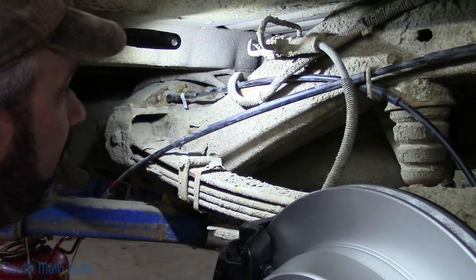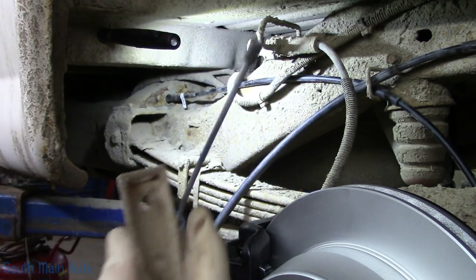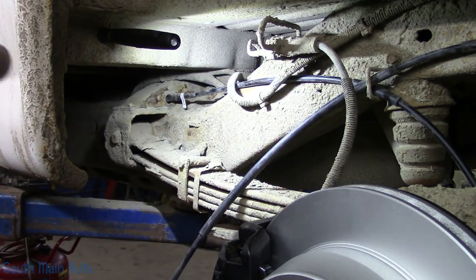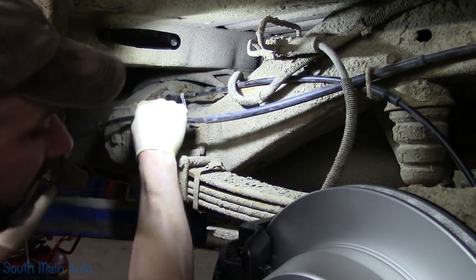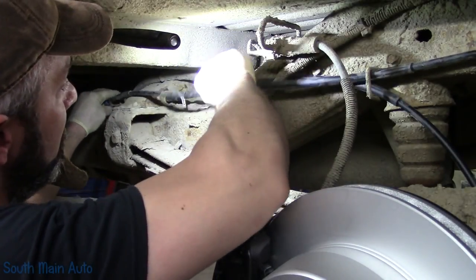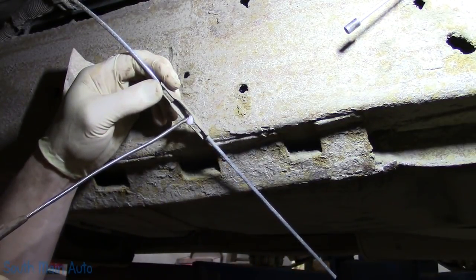There — I just heard it click, it all looks good. I did save this little piece — it goes on our left side cable. We'll stick that on; it clicks through and those are those two little fingers. In a perfect world you could depress those and push them out, however it doesn't really work out like that. You can just take the cable from the other side, that's going to go down through the little keyway, stick it in and pull it. Now we have to release the little donger here on the intermediate cable. I did buy a new intermediate cable, but this one looks pretty good, so we'll give that a try.